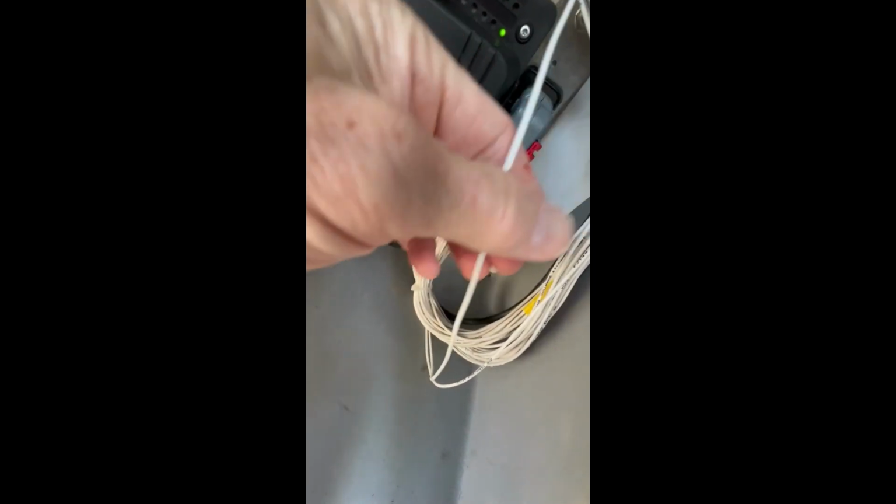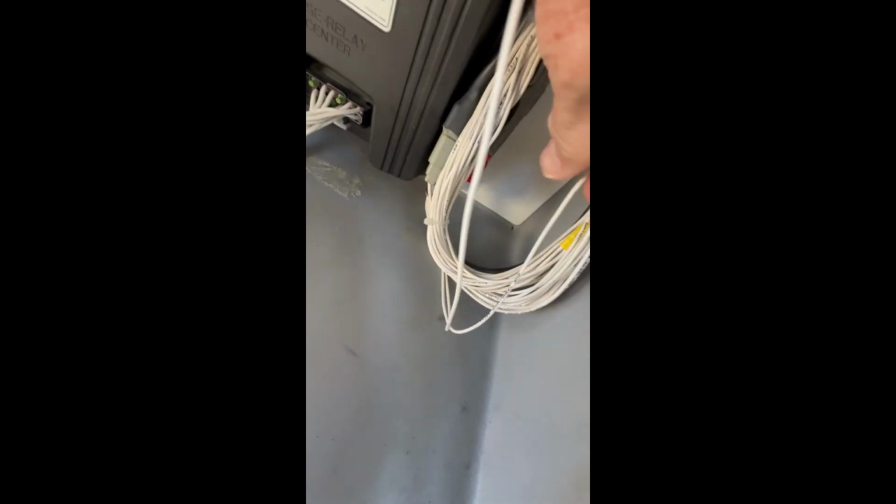to the wires coming out of the J plug. So we've got the ground wire over here. It's in focus enough for you to read it, but it's number 26. And then this is number 27. There it is right there. That's the 5 volt power to the smart wheel.